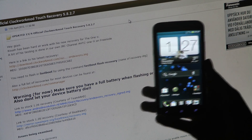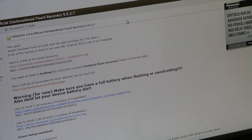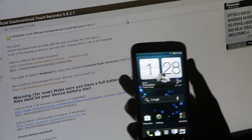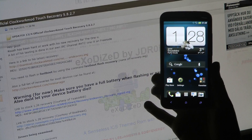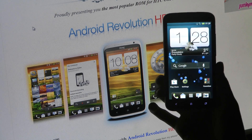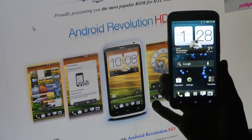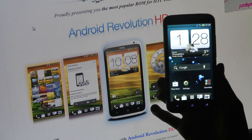What you want to go ahead and do right now — after restoring your device to your original stock ROM — be aware you still have root and still have an unlocked bootloader. Go ahead and start up your device again, and search for an over-the-air update. If you can, go ahead and download that over-the-air update 1.28.